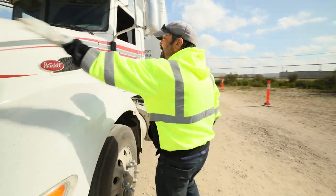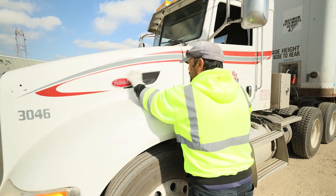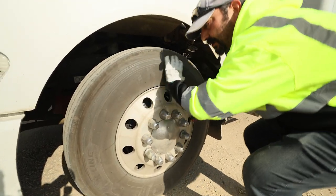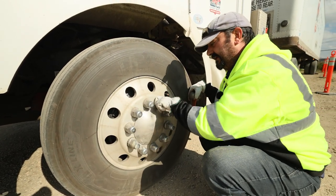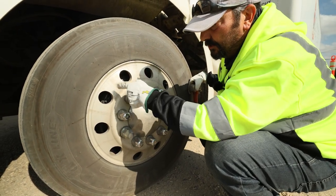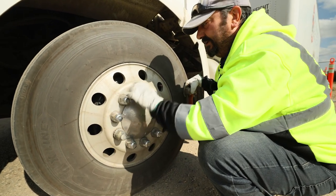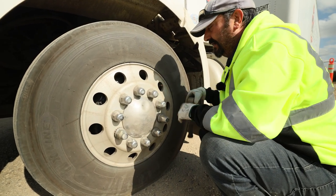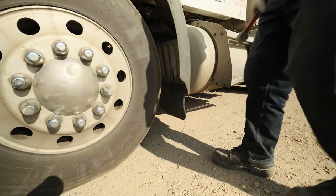Top down, all around. Fender and side of the hood — no damage. Air intake: no obstruction or damage. Hood is secure. Tire: even tread, good tread depth. Check sidewall for bulges, cracks or damage. Rim for cracks or damages. All lug nuts — want to verify no shiny spots, rust streaks or spidering, which indicates moisture getting in behind the lug nut and the stud, backing off the tightness of your lug nuts. No leaks from our hub. Valve stem centered and capped. Tire pressure — we never hit sidewall, always tread. Good inflation.